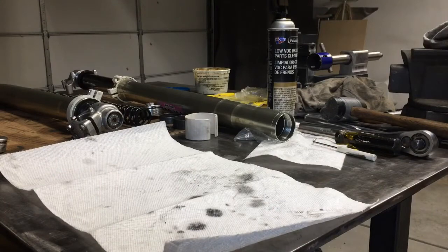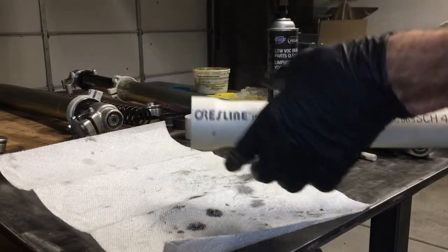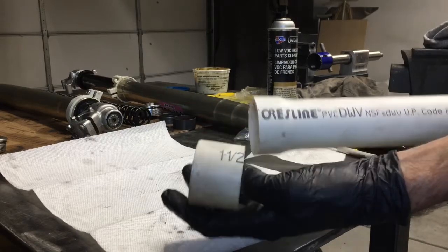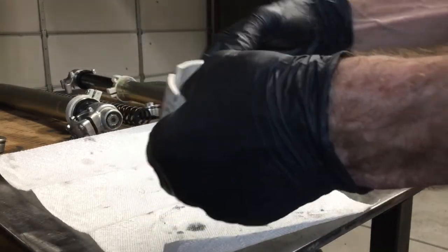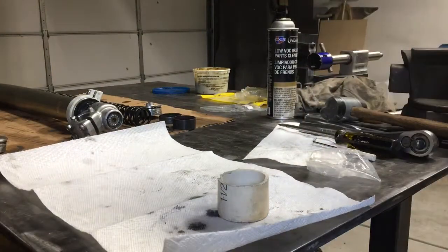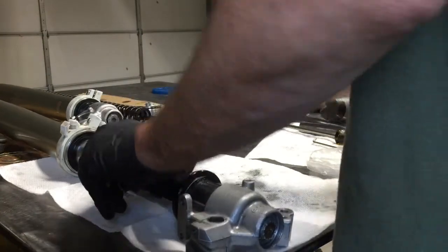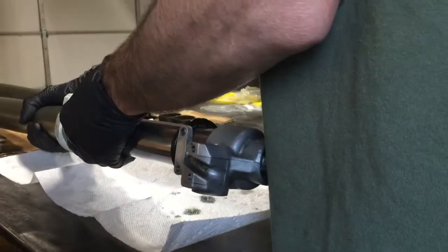For my improvised home-built seal driver — it's a piece of inch-and-a-half PVC schedule 40 with the flared end on it, so it fits over the top of another inch-and-a-half. What I did is I cut it off, made a cut here and a half cut there so it will expand really easy and fit over the top of the fork tube. It pops over the fork leg, fits real nice, and it catches the very outside of the seal — not the center.